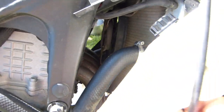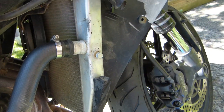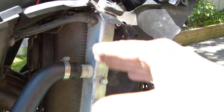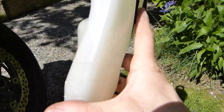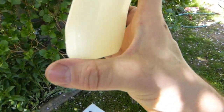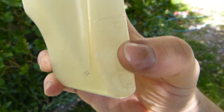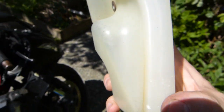The air is going to be bubbling out through this. There should be some liquid in this one too. And keep filling in engine coolant into the radiator. You'll see that the level drops as the engine uses it and works the airlocks out of the system. It's going to keep dropping. By the time you're done, it's a little bit of time and a little bit of experimentation or settling. And let me just show you here in the shade that there is a low line on this reservoir there, and there is a high level there, or full. So keep the engine coolant level somewhere there between full and low, and that's when you're done.